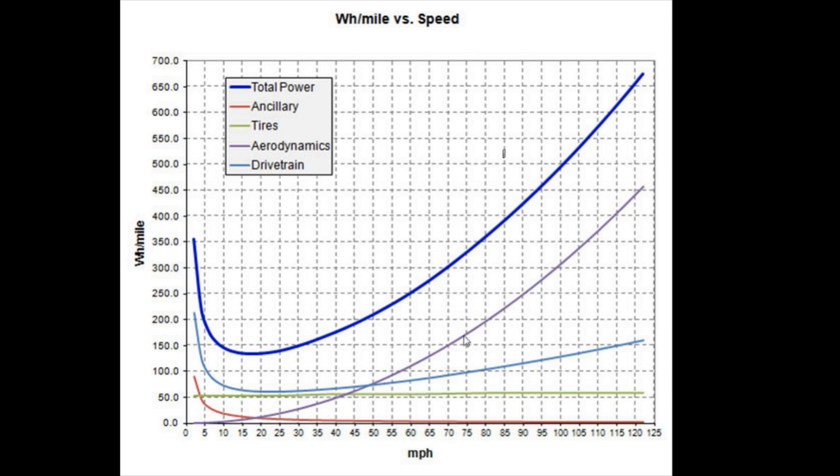The aerodynamics plus the tires plus the ancillary — all three things together — these losses still apply during regeneration, and only the rest of the energy can be recaptured. There's always going to be losses just because the car is moving. Mostly the aerodynamics and the tires — especially the tires at lower speeds — these losses limit the efficiency of regenerative braking. So it's not so much that the generator, the motor, and the motor electronics are inefficient. It's all these other losses that are inherent when you drive a car — they always apply whether you drive or regenerate, and they use up energy which we cannot recapture in any way.